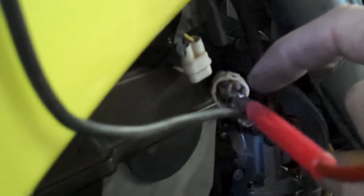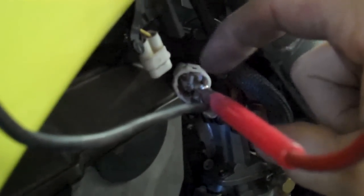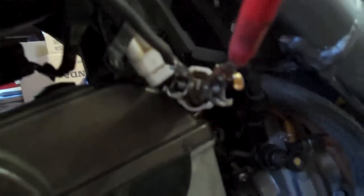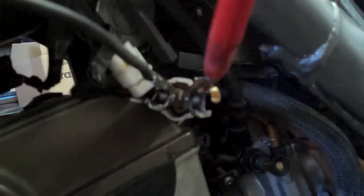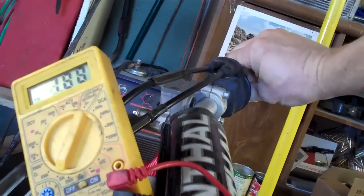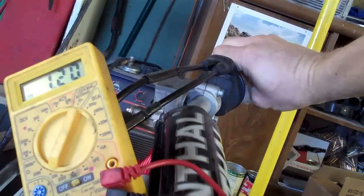In this triangle pin setup - this one's on the right-hand side to the right of the bridge and the bottom - I'll pull the bottom lead and stick it in the top. Now I have the bottom pin open and I'm on each of the top two pins. Same setup - watch my hand as I twist the throttle. See how it decreases? The other one increases, this one decreases.